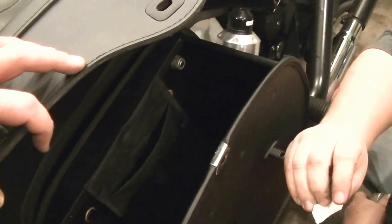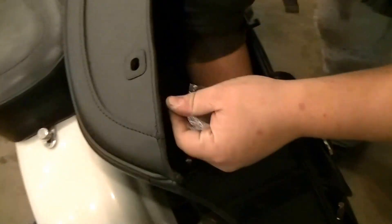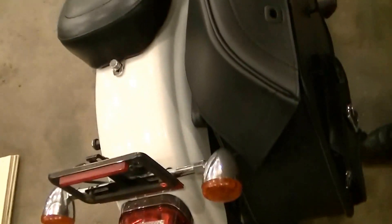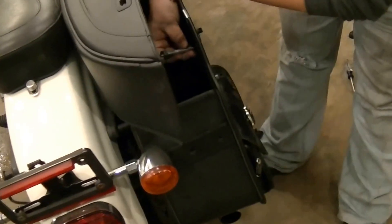As far as the actual bag once it's all bolted down, it does seem to be on there pretty well — you can see I'm shaking the whole bike. It's not a triangulated position, just two bolts, but they're two thick bolts that hold fairly well. The bolts don't state their class, but they don't feel very heavy, so probably class 8.8s. It does seem to hold well; I'd be interested to see how it does over time, but that's just our initial impression.